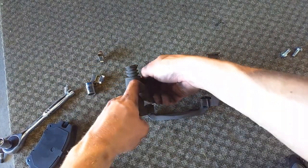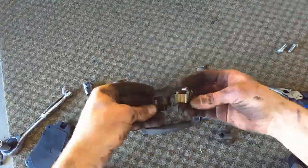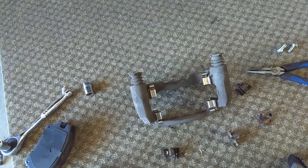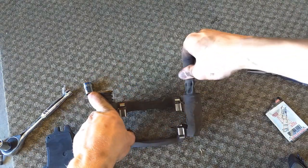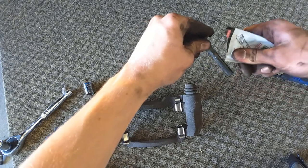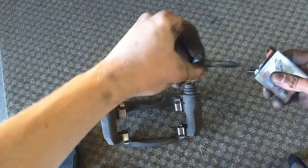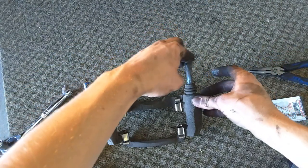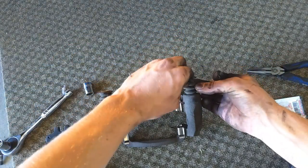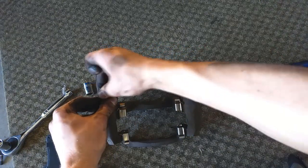Replace the clips, then pull the slides out — help the boot off of them — and put a little grease on the slides. Slide them back in and clip the boot back over, then do the same on the other side.